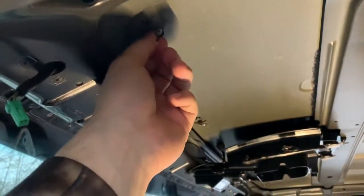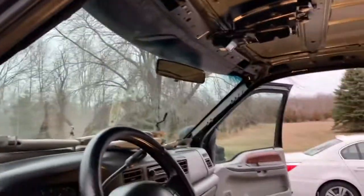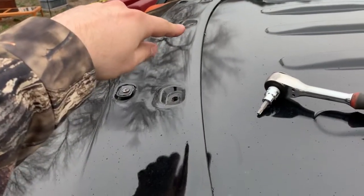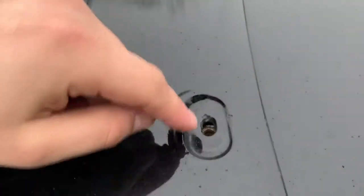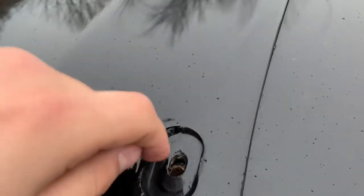So far I got seven of these out — they're all loose. If they're not missing they're loose. On that side the second one in closer to the back was actually tight, but one was missing on the front outside and the front outside on the other side. Since these holes are so big and I'm missing two outer ones — and I think that one's stripped, that one's loose, and this one's loose — I have enough space to go up to the next bolt size.